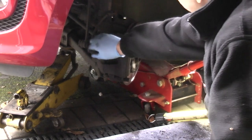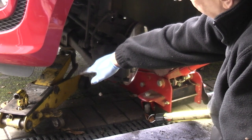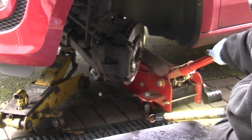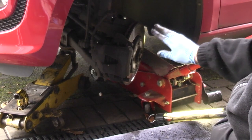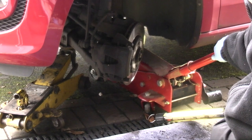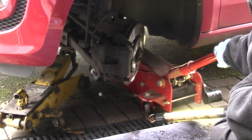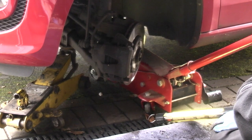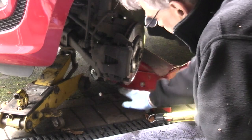I've jacked the car up and turned the wheel so that the caliper's facing out. I have a yellow jack holding the front part; this red one is just a support in case the yellow one leaks or goes down. I'm not getting under the car — if I was I'd have axle stands and remove the jacks altogether. Never trust the hydraulic jack to hold your car up. If it springs a leak it'll let the car down and if you're underneath it could crush you, so always use axle stands. If this goes down the other one will stop it; if that doesn't stop it the brake disc will touch the floor.